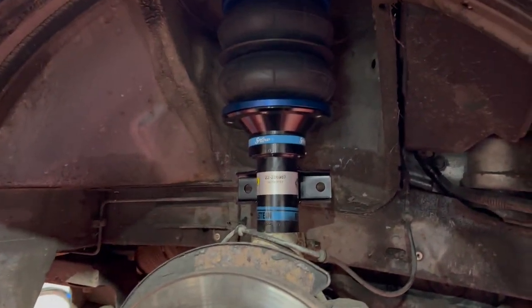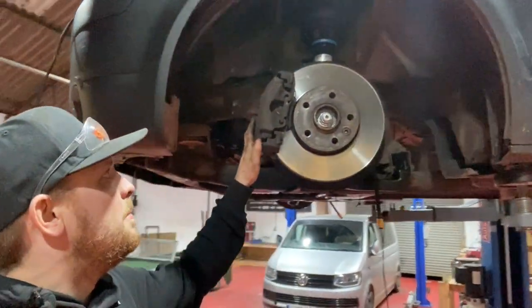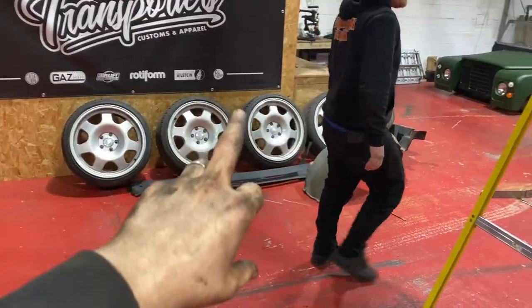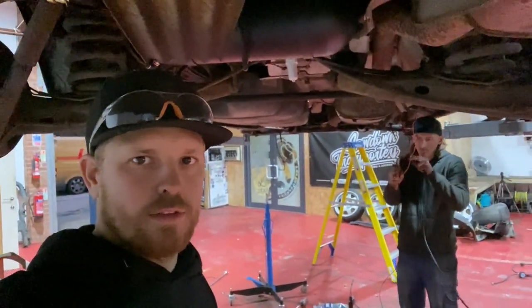Dan, what are you doing? I'm trying to get the strut in the right place — because of the hub mod it can obviously go through, so I'm trying to get it about as far down as possible so the wheel is as far up as it will go. I think there's a little bit of room — we'll have a go, we'll cut it up and make it work. There are the struts all in — looks very pretty, very nice. Front struts are in both sides — they were a bit of a pain to get in through the hub, as it was gripping. A little bit of copper slip, opened it back up again with the chisel, a few hits with the hammer and it went in. Hub-modded as well — just off the CV boot, so that should get us tucking the wheel, not the tyre.